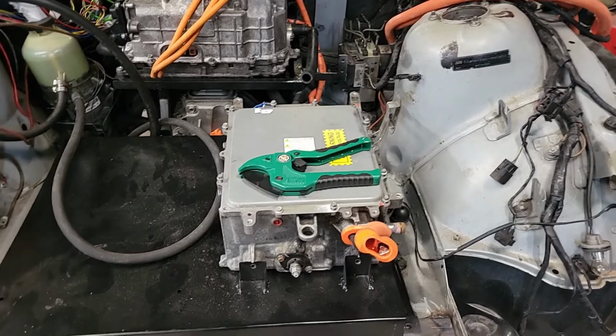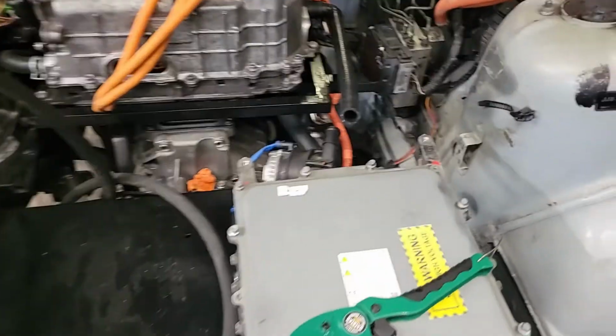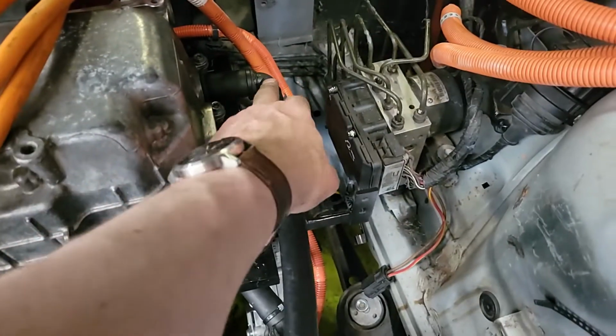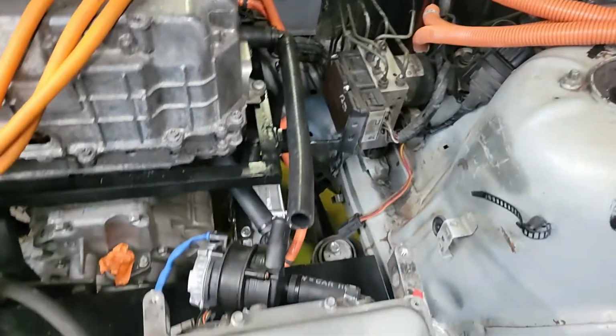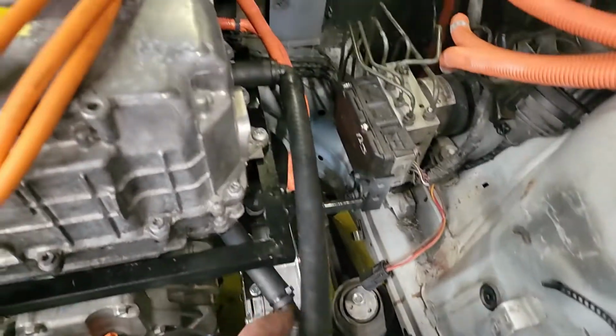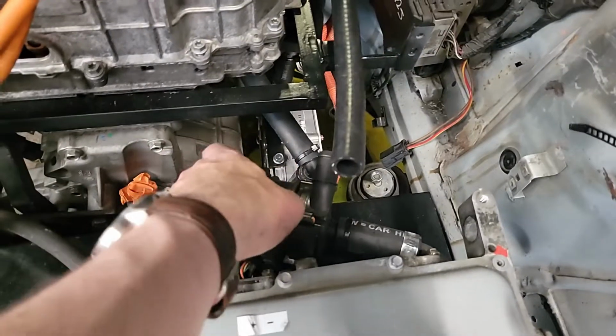So I'll need to do 16 to 19mm adapters, which is quite straightforward because with these elbows, with a bit of heat, it's very easy to get the 16mm over the 19mm elbow. And there's going to be a couple of elbows around here as we go into the radiator. But at least we've got a template for our part now. We know what needs to go in there.